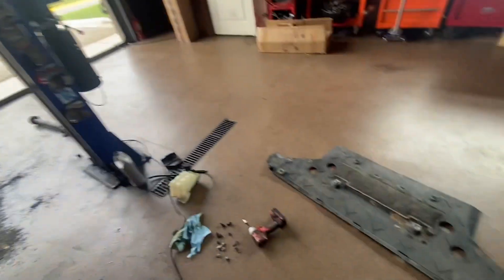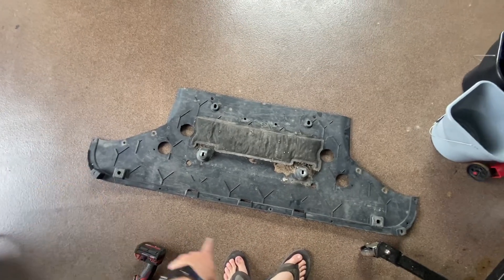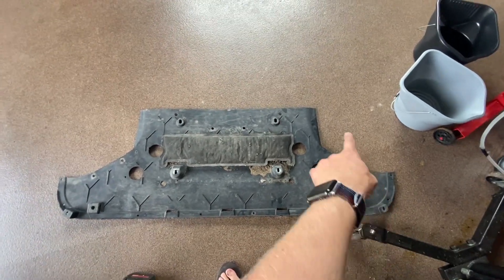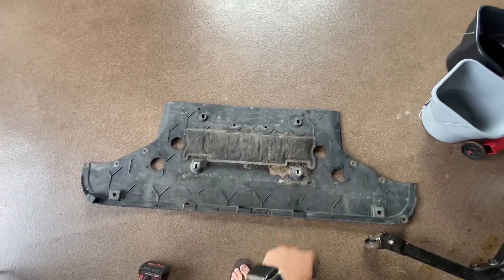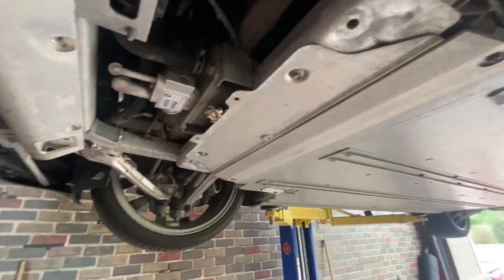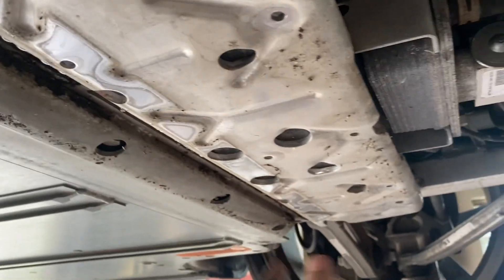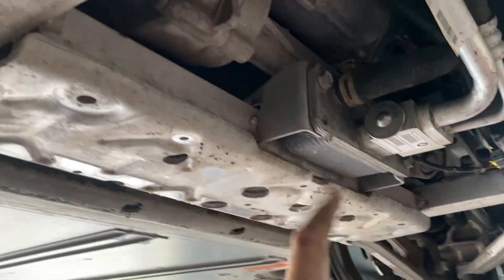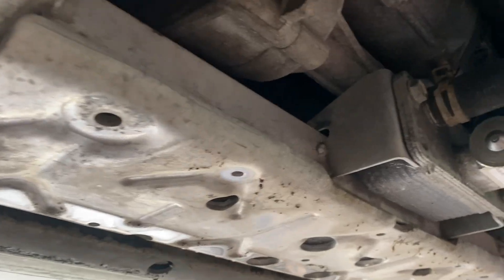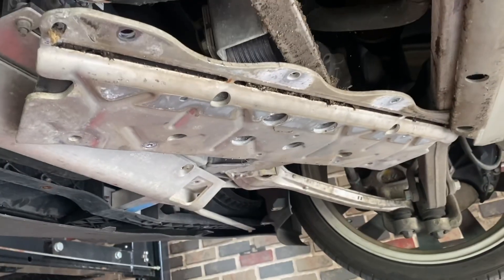All right, the front is off. They were actually Torx T40s in the middle. I only had four remaining little push clips around the end and two really big ones in the back — hopefully yours has more than that. Next up we've got another two tens, two actual T30s, and I think there's another plate under that as well. Those two pieces are off, and it looks like I have to take some 13s out and get this out too. The drive unit is right up behind the steering rack, so I'm not exactly sure. So far this is really stupidly designed.